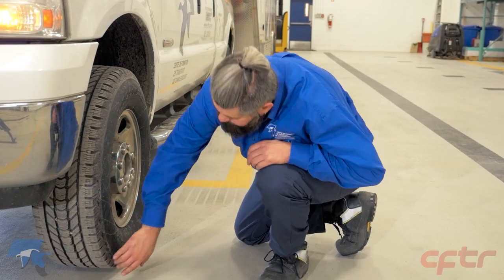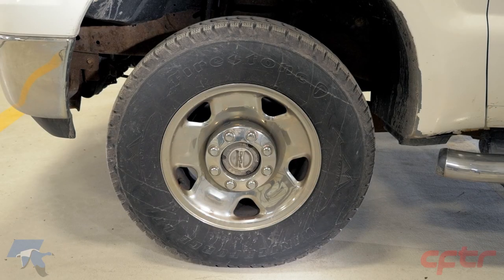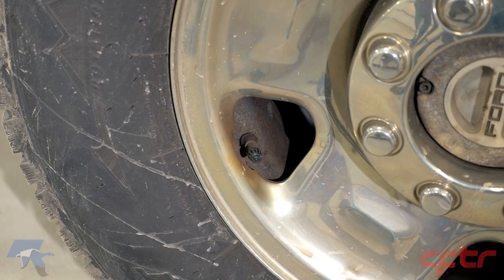For tires and valves, look at the depth of the grooves of the tread. This should be checked on the entire visible part of the tire. Check the general condition of the tire and note if there is any presence of wear, damage, foreign material, or bulge.